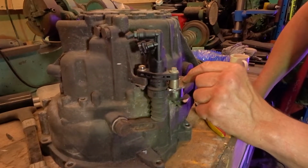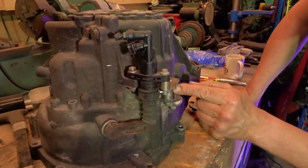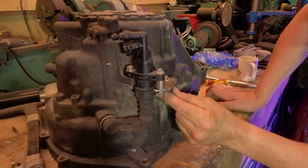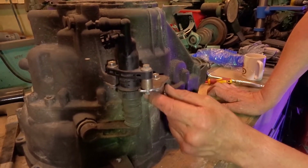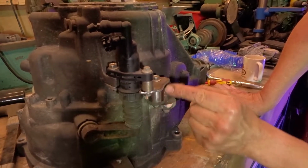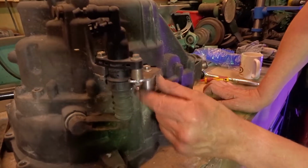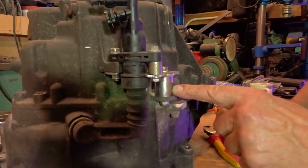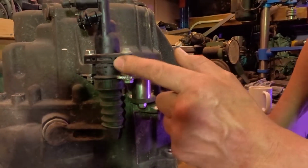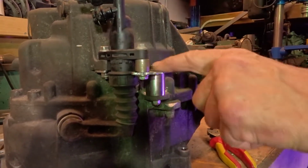We can cut a load of that back off round there and round that bit. I'm going to put a smaller spacer on that. I think that's far too thick. I'm going to go down to that size, but that same height. So that's 35mm high, and then that tidies it all up. And obviously, we won't zinc plate these spacers, but we zinc plate just that plate.